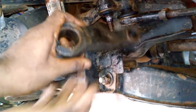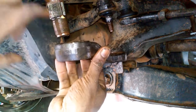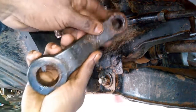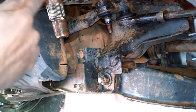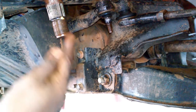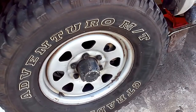We have the arm removed. Remember the index point with the shaft — pay careful inspection to make sure it has no cracks and is not twisted. Now we can proceed to removing the steering wheel shaft from this steering box.